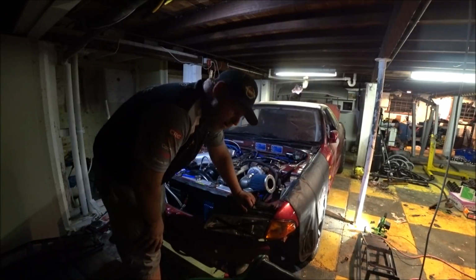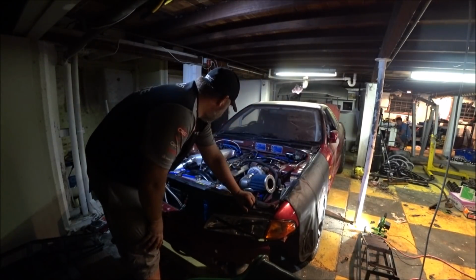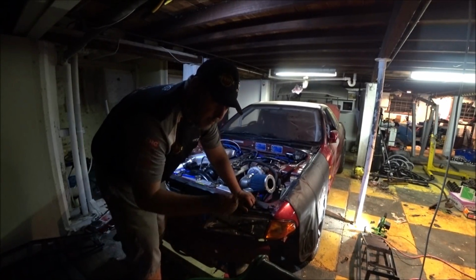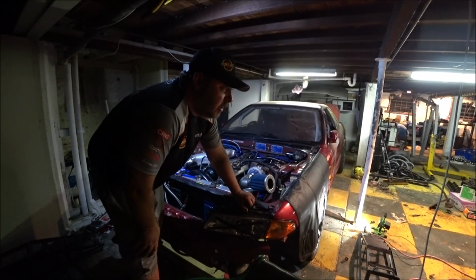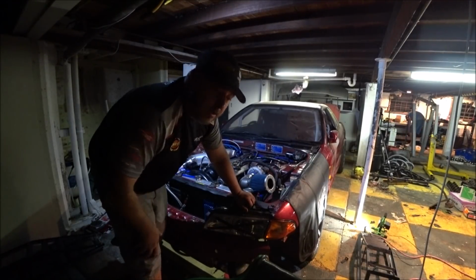Well, it spins around, apparently. So I was told. But the battery's lost all its juju. When I was testing to check what I needed to jump on the relay to make it pump fuel, it only had 10 volts. So I had a suspicion that might happen. I did look for the charger earlier, couldn't find it. But I'll have a proper look now.